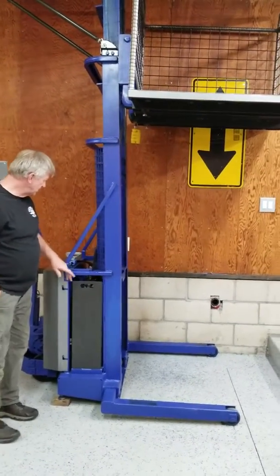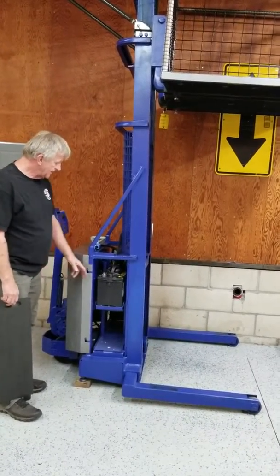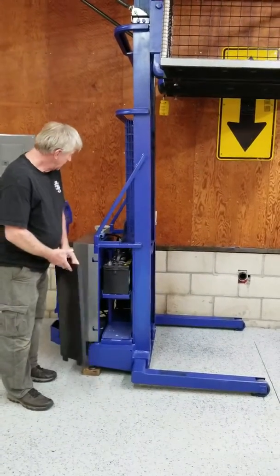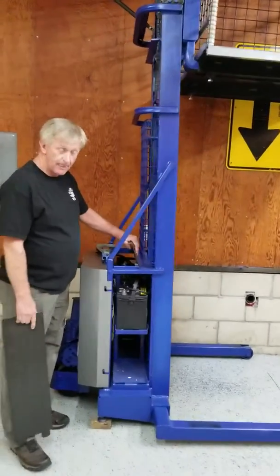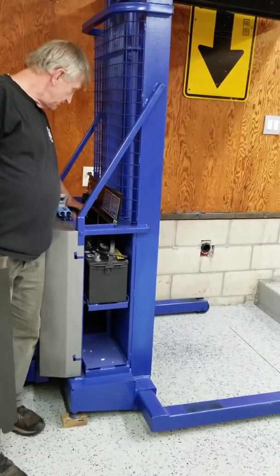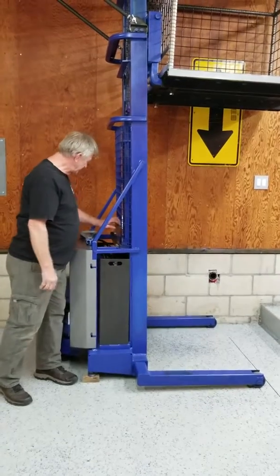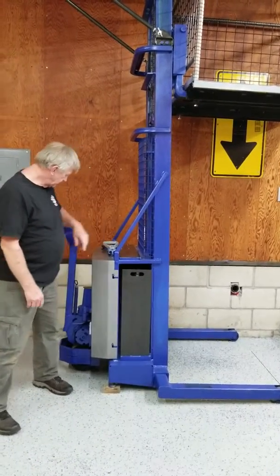Just to make things simpler: this is wired with four batteries originally, but it's not running around a warehouse all day. Two 12-volt batteries is enough to get your 24 volts. No sense spending extra money maintaining four of them. I also don't use the 24-volt charger — I just use a battery tender. I swap batteries with the battery tender by moving the terminals over to this side. It automatically maintains the charge level, and you don't have to mess with the big plug every time.